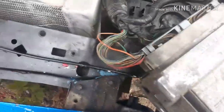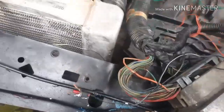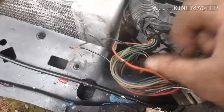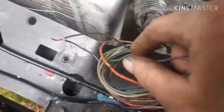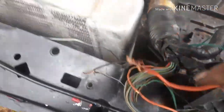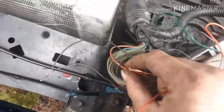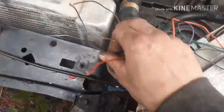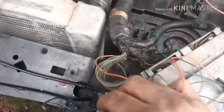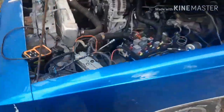So what we're going to do is take pin two from your serial data port connector, which is the purple wire, and splice that into this green wire, which is pin 58 on the blue connector for your PCM. Your 12-volt constant wire on your OBD2 port will be pin 57 on the blue connector for your PCM. I got pins four and five spliced together that I'll be wiring to a ground, and I'll show you all here in a second how this all works.